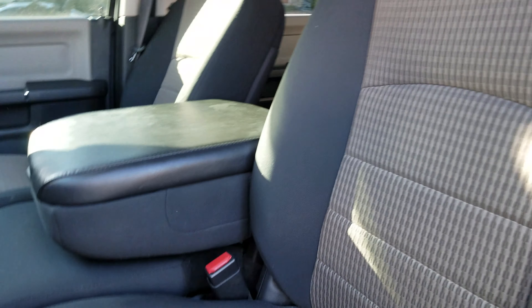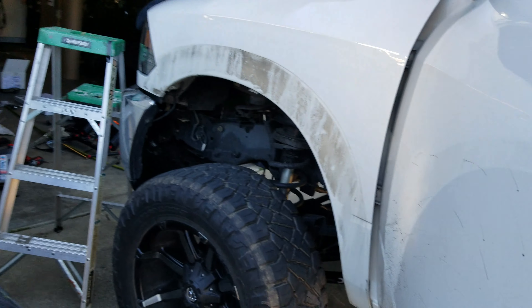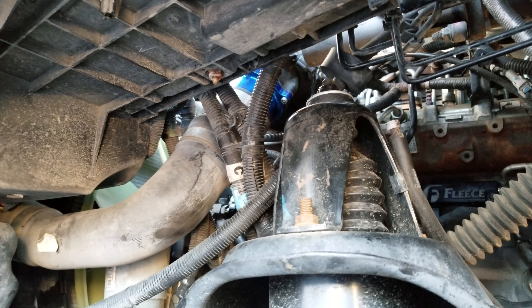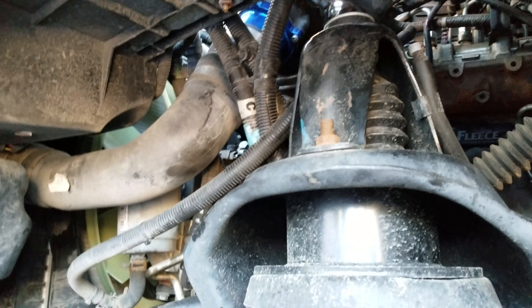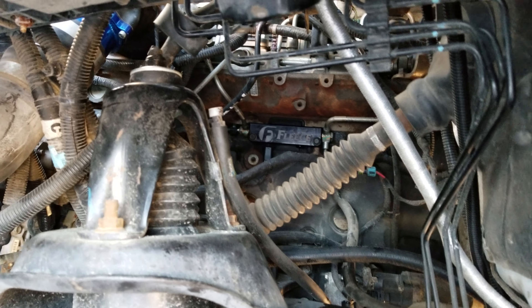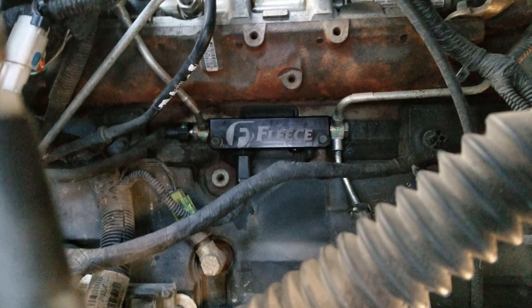That's my review of the AirDog. Haven't got to drive it around yet. One more thing: if you're doing the Fleece Performance fuel filter block-off plate, it's easy to see if you just remove the intake horn — though my aftermarket intake horn was a pain to get off. I came in through the side; it's a little bit of a reach but it worked out. The Fleece Performance block-off comes with new copper crush washers for the banjo fittings. So far, I'm impressed.